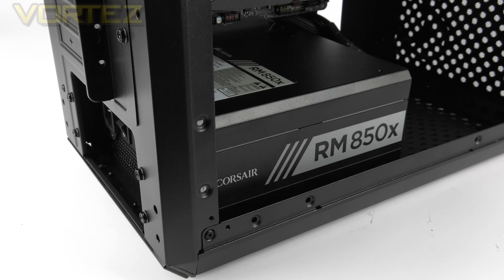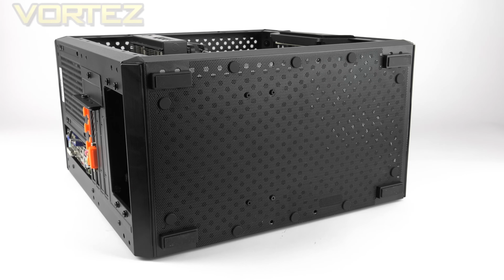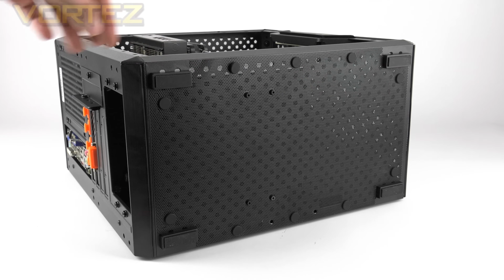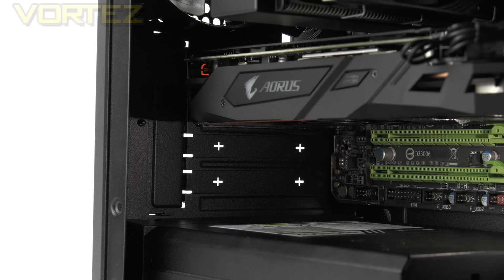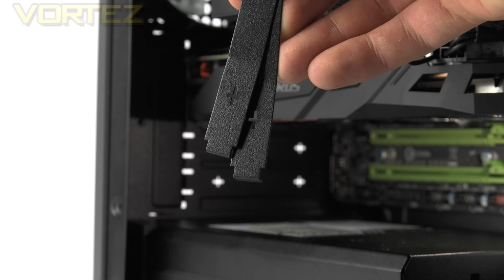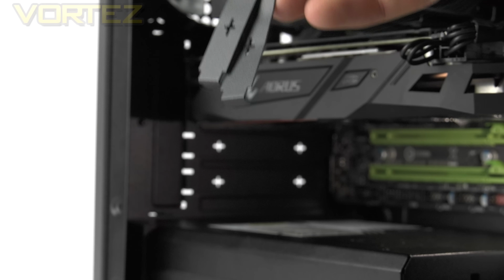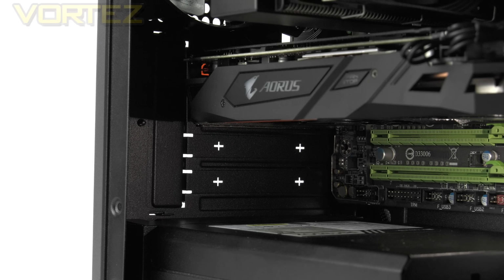Length restrictions are minor and more of a nod to neat cable management. In this configuration, air is typically drawn through from below. We should note that removing and cleaning the floor filter does require that the case be placed on its side. One thing we're not a fan of are the rear PCI slot covers, which use the cheaper metal pushouts rather than replaceable covers. Care needs to be taken when you remove each, as it's possible to leave sharp edges or slightly warp the metal. You'll have 4 slots available, letting you install up to 2 dual slot graphics cards.